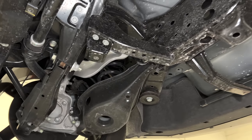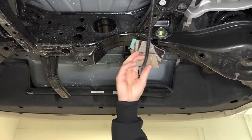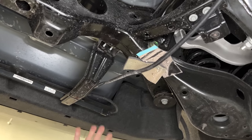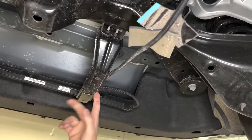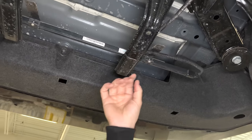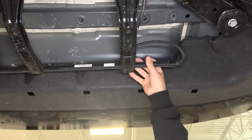As we talk about integration, one of the things that catches my eye back here is these lights, the harness, and some of these NVH pads, or BSR, buzz, squeak, rattle, foam patches. They're going through a lot of effort to get these lights into place. They've got these bolt-on brackets that are cantilevered over. It's nice that they're getting two functions for one: they're using these fasteners to help support aero shields, and they're using the brackets to help with that as well.